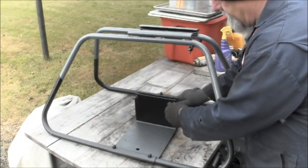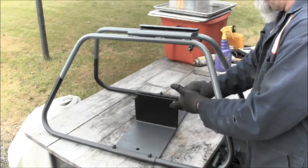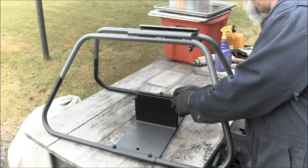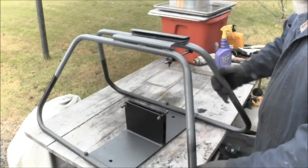And then down here the skeg goes into here, and then you would just take your nut and washer. Once you slide the skeg in, you put that there and you tighten those two bolts. You just squish the skeg in there real good with those two bolts, and it'll clamp it. It's got rubber in there too. So that's what they look like.